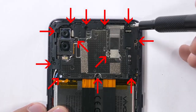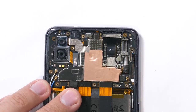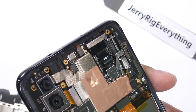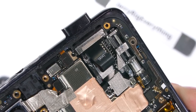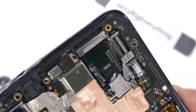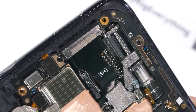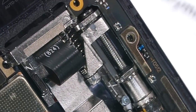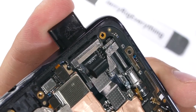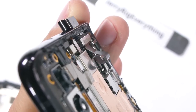There are 12 screws holding down the metal plate over the motherboard. Pulling that off gives us our first look at the camera raising mechanism. It looks like a lead screw stepper motor is doing all the work — the motor on the right twists the screw, which raises and lowers the camera in and out of the phone. The camera receives communication from the motherboard like normal with one of those Lego connectors, but this time has a really long flexible ribbon so it can keep moving in and out. The large spring is probably to make sure nothing gets damaged if the camera gets bumped — it absorbs the bump instead of hurting the lead screw with the motor. Pretty smart of Vivo to design something like this.